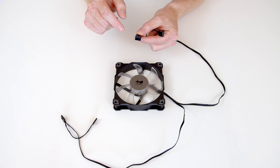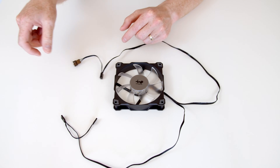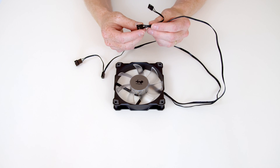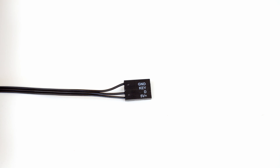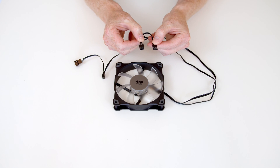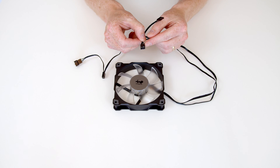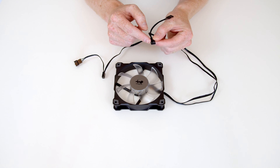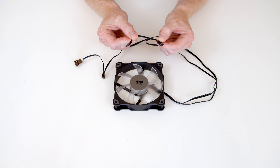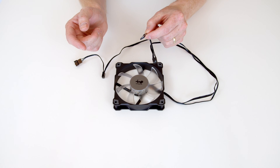And then if we want to add the third fan on, we're going to repeat the same step on the second fan to allow us to add the third fan on. It's exactly the same story when we come on to the RGB cable. On the end of this we have a three pin five volt addressable RGB connector, which is going to plug into the addressable RGB header on your motherboard. If we look at the end of this connector and cable we've actually got two identical plugs, and it's exactly the same story when it comes to daisy chaining. So we're only going to need to use one addressable connector on our motherboard — we plug one end in, and then we have the other little connector free to plug into our next fan, and that fan's spare cable will allow you to plug the third fan in.